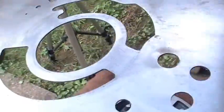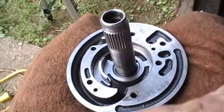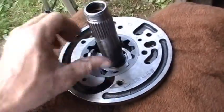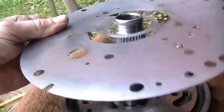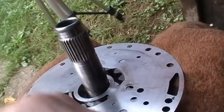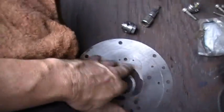Your main concern is the plate. As long as you don't have any major wear there, you're okay. Also no major wear down in there and you should be good to go. When you put all this back together, you put your gear back in there like this, and you can put a feeler gauge in there — you can see that is really almost perfectly across there, smooth. Then when you put your plate on and bolt the other piece on top, that's what keeps that gear in place and builds up the pressure. As long as you're okay with the clearances on your gear and the plate isn't damaged too much, you're good to go.